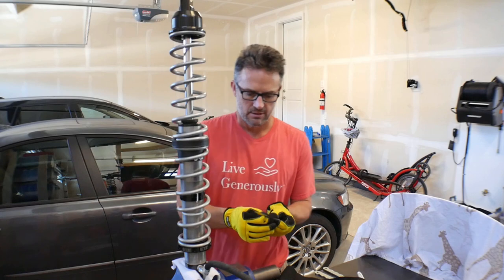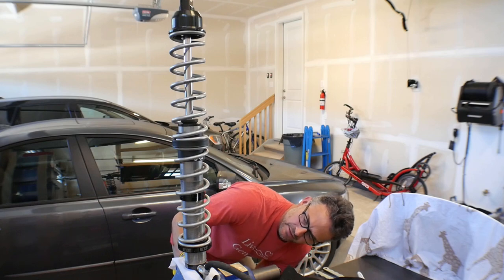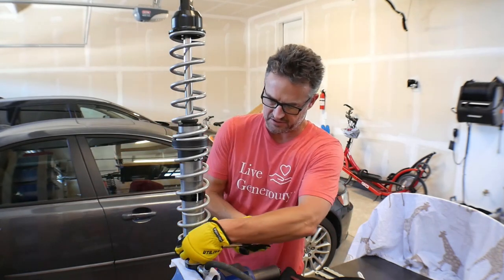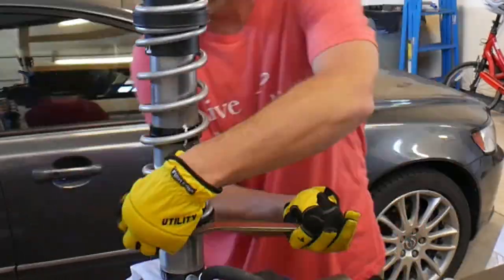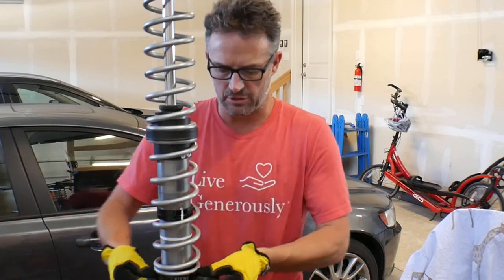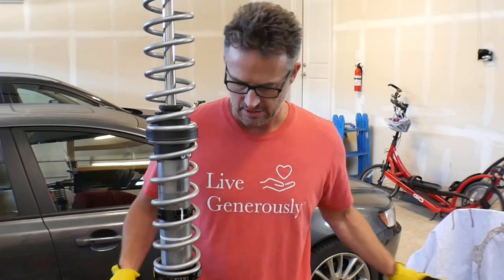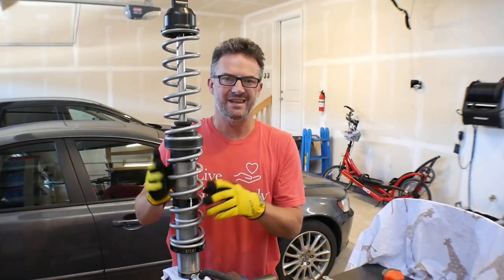I've got a little ruler here and I measure to the threads — right now I'm at 38 so I just crank it up until I'm at 60. Now this is set at 60. I'm not going to lock it down yet, because once I actually bolt this into the chassis I'm going to rotate it so that the cinch nut is easily accessible. I'll do that once it's in place. But that is it for setting up the initial spring setup.